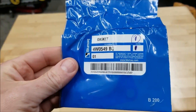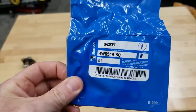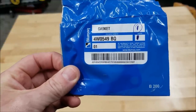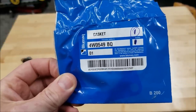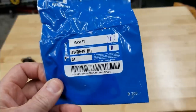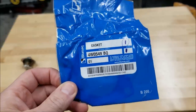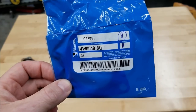I've got a couple things going on with Abel — well, one main thing. The reason I'm replacing the thermostat is because I don't even know if he has one. It could be one of three things: the truck is behaving as it should normally, there's no thermostat at all — which is my guess — or it's stuck open. It takes quite a while for Abel to heat up while driving, and from message boards I've heard it should take 10 to 15 minutes to reach normal operating temperature. We're seeing 30 minutes to an hour and a half, so something's not right.